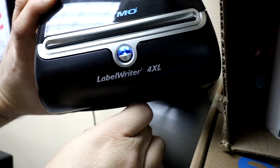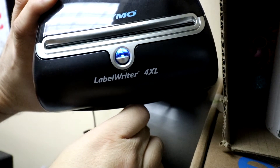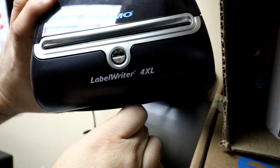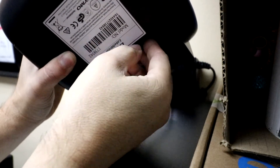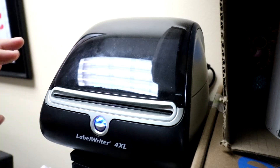You're going to notice that there is a capacitor light that's blue — wait for that to go off. It stores a little bit of power in the capacitor, and you'll know it's fully discharged once that blue light goes off. It usually takes a few seconds. Then you simply plug the power back into the unit and it will initialize.